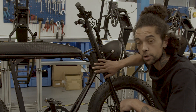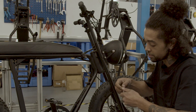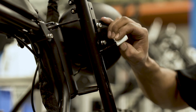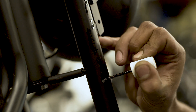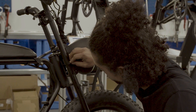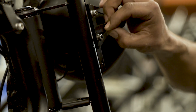If there are any scratches or damage to the paint going down to the frame, I recommend touching it up. The RAL code for our bike in black is 9005. Get in contact with a local paint dealer, give them the RAL number and they can mix it properly. Get a brush, cover up the scratch a little bit — I feel like Picasso today. Then use a small microfiber cloth and dab on top to spread it out and help it simer into the existing ground paint. Leave it to dry.